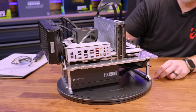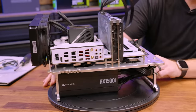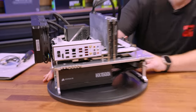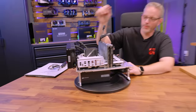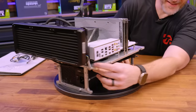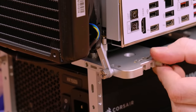Alright, there it is - all put together. This is my Intel 12900K rig on my Open Bench Table. It's pretty sick. Obviously we have a 360 radiator. All I had to do is flip the fans around so the air blows through the rad onto the motherboard and cools the VRMs. You can kind of see the brackets right there - those are the ones that were mounted to the board. We still have spare screws here, and we have the hold-down for the graphics card.